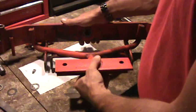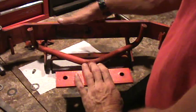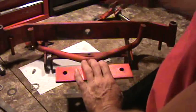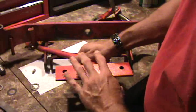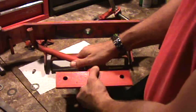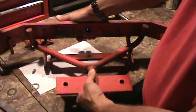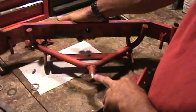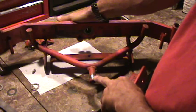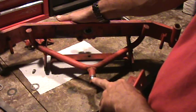When you've got this assembled and you're just doing preventive maintenance — greasing your kingpins and whatnot — it's a good idea to take the load off your axle by jacking it up and letting the axle tip forward. That will take the pressure off here. Load it up with some real thick, heavy, sticky bearing grease, and do that often. That will help keep the wear to a minimum.